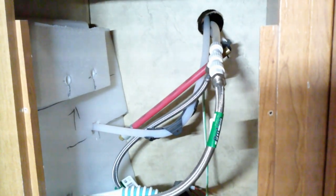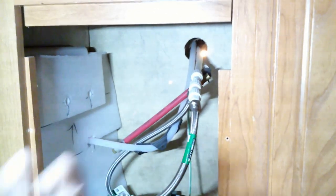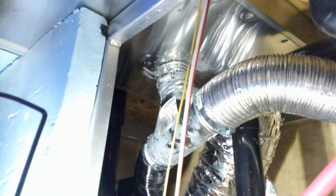Here I'm in the living room of my RV. These cabinets contain various things like a coat closet and DVD players. This particular cabinet did not have a cabinet door - it just had a blank panel. That is where the RV manufacturer hides where they're bringing in the water for the RV. The reason I've had that panel removed is to keep these pipes from freezing - I've actually had a heat lamp aimed in there. My plan today is to add ducting into this panel, heat that chamber, and then install a register in the panel so that warm air will come through and heat the living room, adding further utility to the diesel heater.